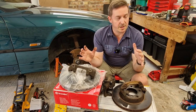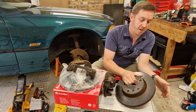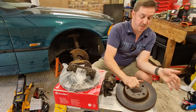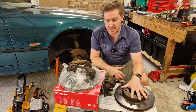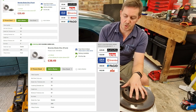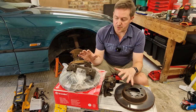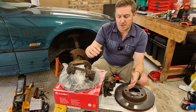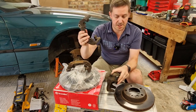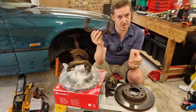So what is the cost? Well, this is my old disc for my 325i — as you can see it's not in particularly good shape, so I needed new discs anyway. The price difference in the UK between a 286mm disc and a 300mm disc is just three pounds. It's a very cheap upgrade from a disc point of view, and the discs are commonly available in all motor factors in the UK. When people know what they've got — a potential cheap E36 brake upgrade — they're asking 20 or 30 pounds each for the caliper carriers.